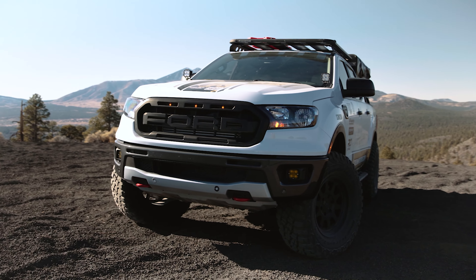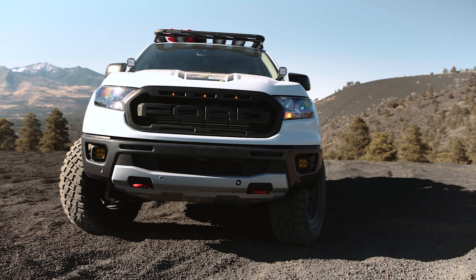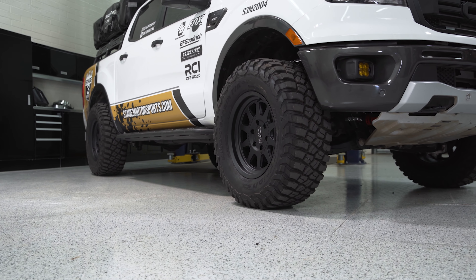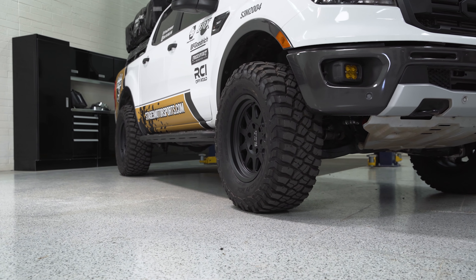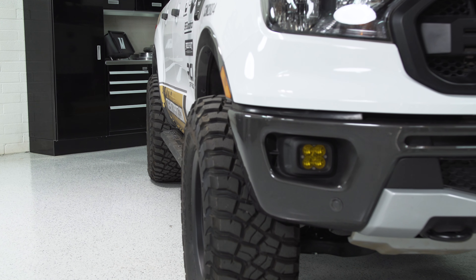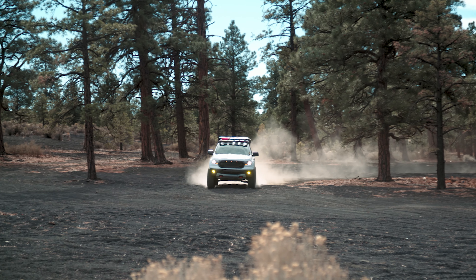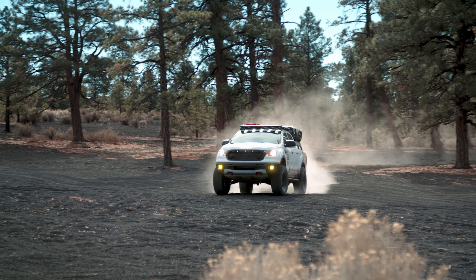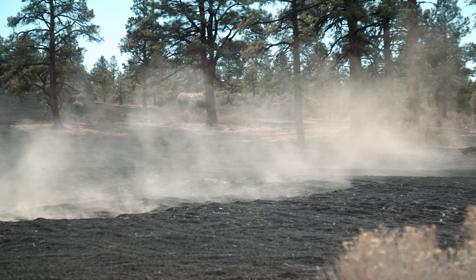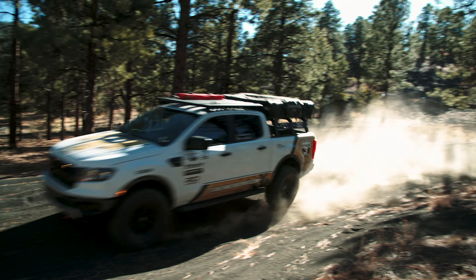In terms of wheel and tire fitment, depending on the height you're running you'll fit different tire sizes, and wheel offset factors in too. For our Ranger at two inches of lift, we're running a 285/70/17 BFG KM3 — their newest mud terrain — on a Black Rhino Stadium wheel, which is a 17 by 8.5 inch wheel at zero millimeter offset. Now let's talk about the real meat: how this system performs off-road and the benefits of a 2.5-inch coilover kit.